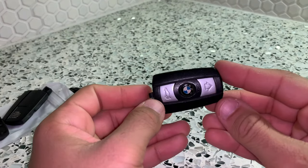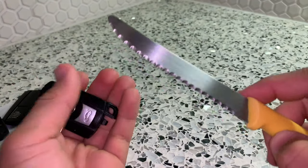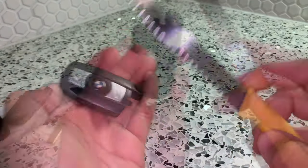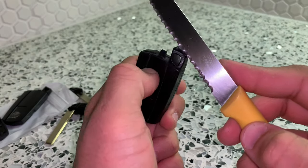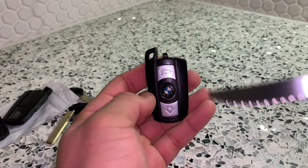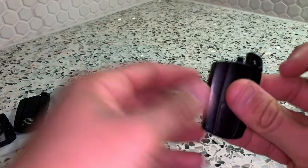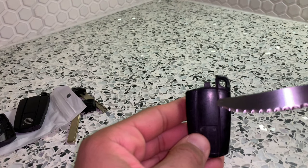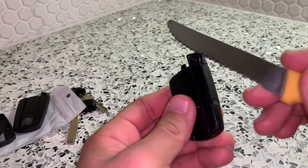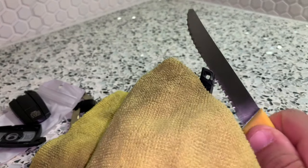For this next step, I'd highly recommend you use a pair of protective gloves — I might cut myself, so do not do this without gloves. A good place a lot of people start is from right here in this corner because of the chip. If you look up a picture, I'll leave a link down below for the actual chip layout inside. The battery itself is right along over here. Whenever you're cutting this, just make sure you're not cutting too deep to where you damage the chip. I went ahead and grabbed a cloth — this way is a lot safer.